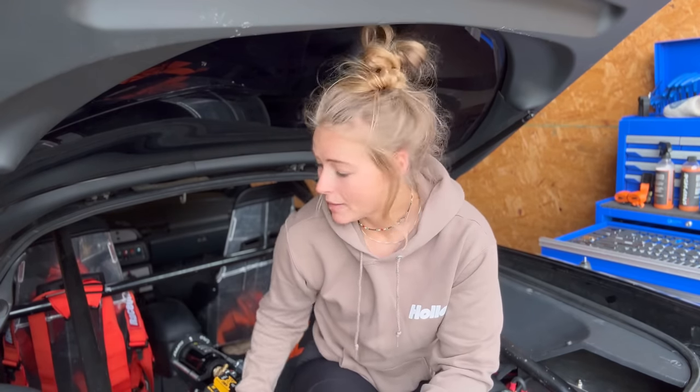If you've already gotten the bracket and the bottle and you're just like, wow, I don't know where to mount this, I don't know how to do this, or you're just overwhelmed, remember, it's really not that hard. Nut inserts. Literally get yourself a nut insert kit off of Amazon. Super duper easy. That's actually how I mount my nitrous bottles back here as well. And maybe that'll be next week's video, because I need to do a video on that.